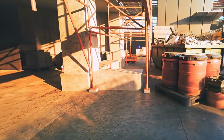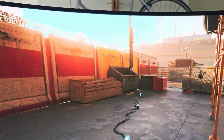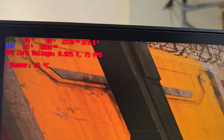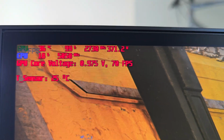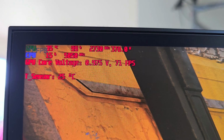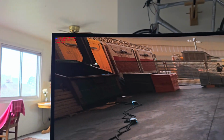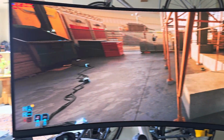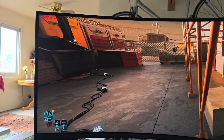25 degree water temperature at 67 degrees Fahrenheit, which is like 20 degrees Celsius. So I'm 5 degrees over water. Full tilt, RTX 4090 at nearly 400 watts, 370 watts. So that's a reduction of water temperature from 11 degrees over ambient to 5 degrees over ambient. So I got a 6 degree reduction in water temperature.